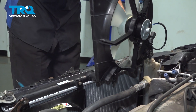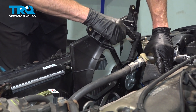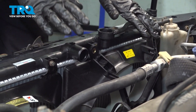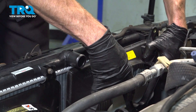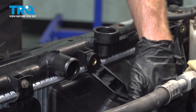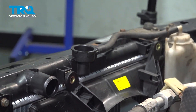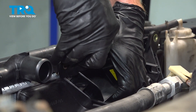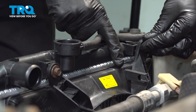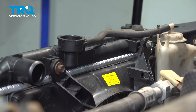We'll carefully take the new fan assembly and slide it down into place, being extremely careful around the radiator. If you need to flex the AC lines, you can do so — just be careful not to cause any damage. As we bring it down, we're going to be paying attention to the alignment points. We want to make sure that they fit over those bolts and that we're as close to the radiator as possible. Once you feel it's in proper position, give it a little tug to try to pull it away along the bottom. Assuming it feels secured, continue up along the top. Start in the mounting bolts, snug them up, and torque those to five foot-pounds.